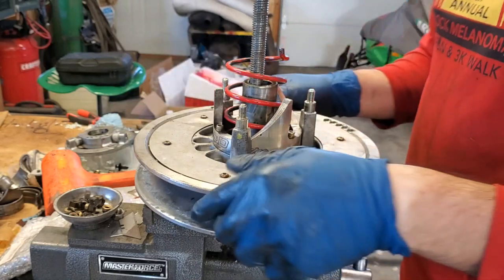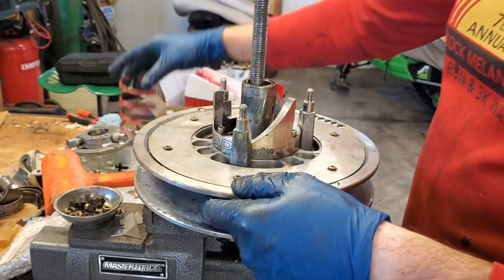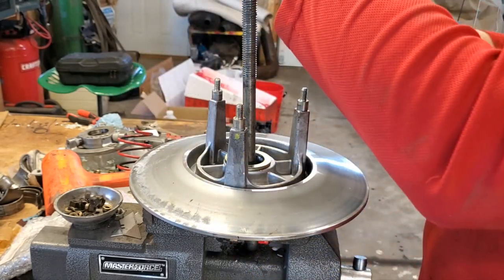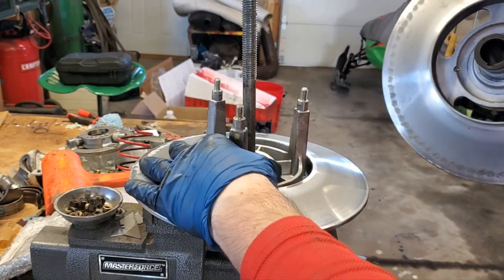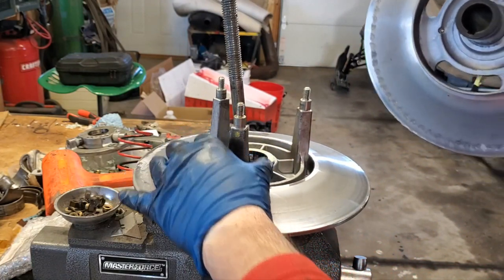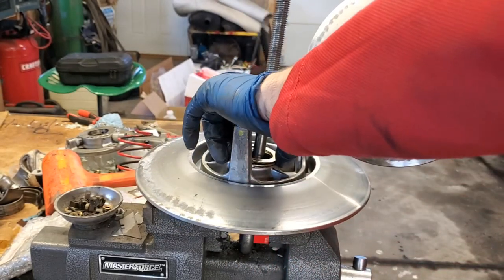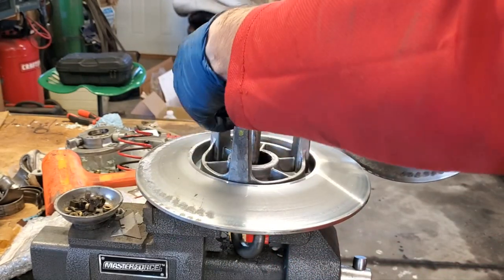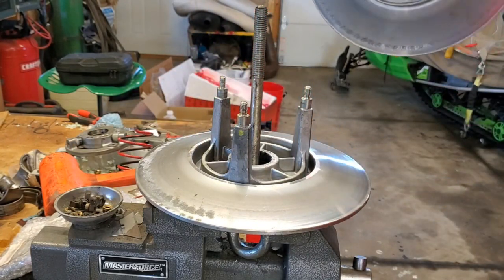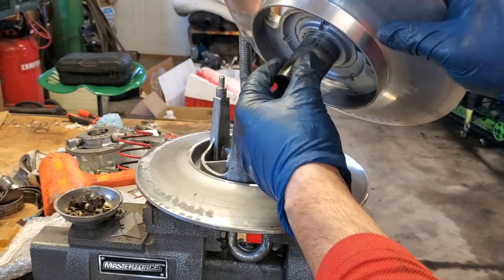Okay, now we can go ahead and separate our secondary. It doesn't hurt to take the spring out and set it off to the side, but now we come apart here. Keep in mind there are shims, spacers, in here, so make sure you keep track of them so that they go back in where they were. So I'm going to go ahead and remove those right now and set those off to the side as well. Okay, so what we need to do is check the diameter of this shaft right here